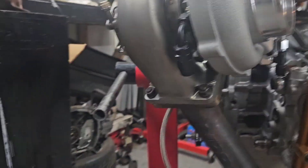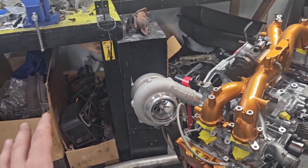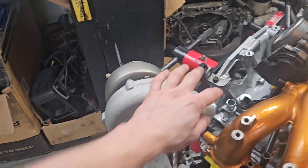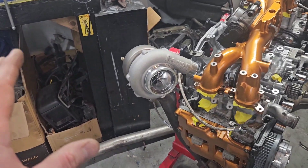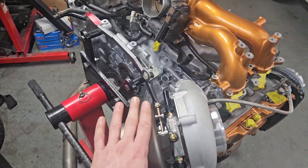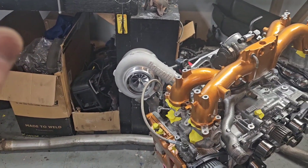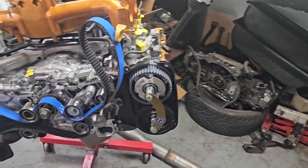This turbo is very heavy, but it's still considered a small-frame turbo. The G30-770 is like a 54-60 — a 54mm blade — it just looks really big. We've got a big four-inch intake and two-inch outlet, so it's pretty much the same frame size as the old GTX3582 but much more efficient. This is the 0.83 AR exhaust housing, so it shouldn't be too laggy — it should light pretty quick with a 2.5-liter. I've always wanted a legit Garrett turbo like this; it's like a dream right here.